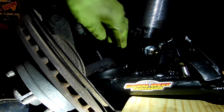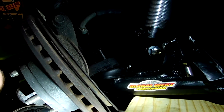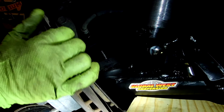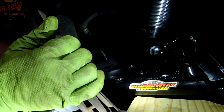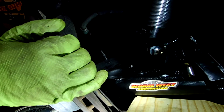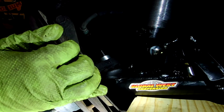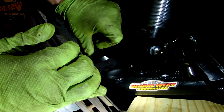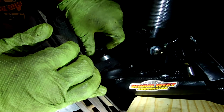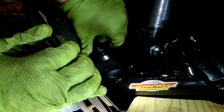Then you can throw on your spindle. Here I actually have the disc and everything still on the spindle. Don't forget your spacer — like I said, that's important. Then your castle nut. Just run it down by hand for now, because we've got to get the top half of the spindle into the top ball joint.